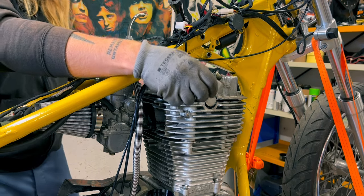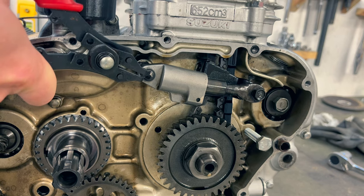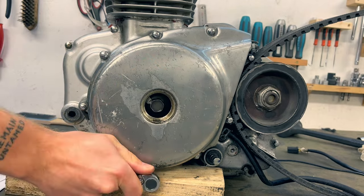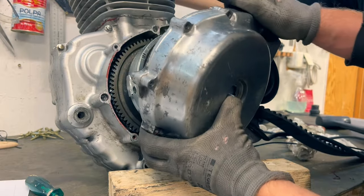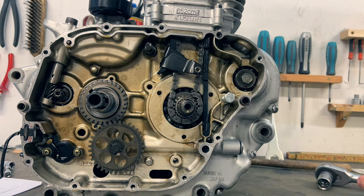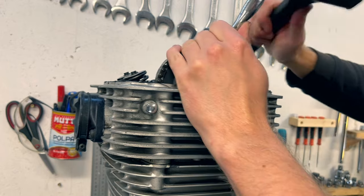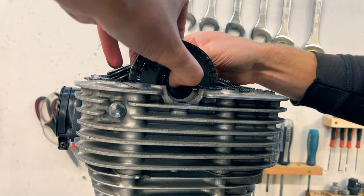And this is where I realize that I will have to take the engine out. And just like that, it's on the workbench. To remove the primary drive gear nut, you must hold the generator rotor with a 36mm wrench. In order to do that, you have to remove the left side cover as well — it contains a strong magnet, so it can be a little difficult to remove. Also remember that this nut is left-hand threaded.